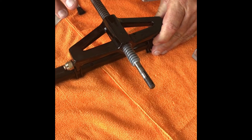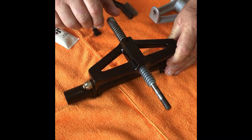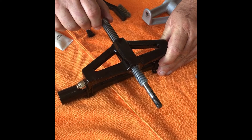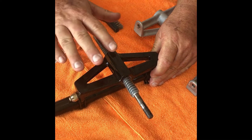This thing was really full of grease and appeared to be tight — very stiff because it had such old grease in it. But look how much play there is after it's been cleaned up. It's amazing — even up and down play. This is definitely an unacceptable jack screw and yoke right here.